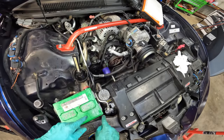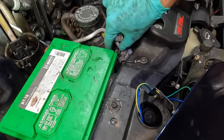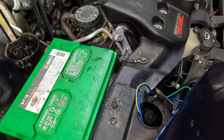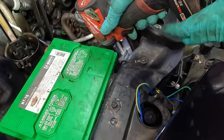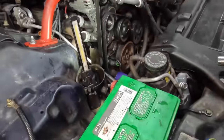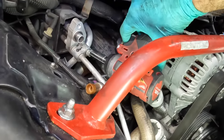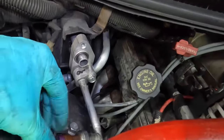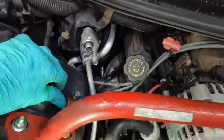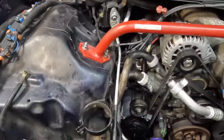There's one of them. I need to find the bolt that goes there. Okay, bolt coming in. Get that thing started. Yes, I have new seals and gaskets on all these components here. We've got the 13. There we go. And let's plug in our high side switch. Get that guy connected right there. And now, let's go ahead and unbox the receiver dryer and get that thing bolted in.